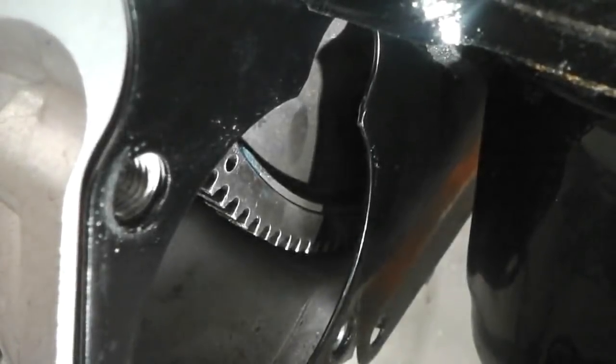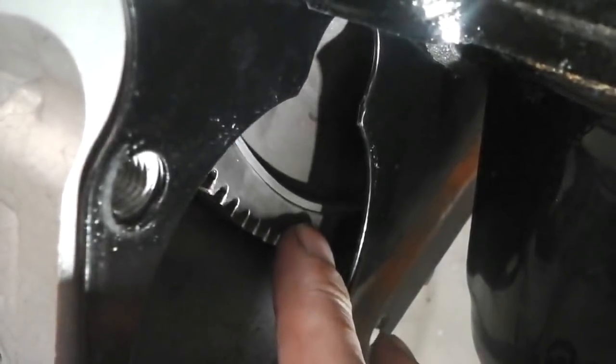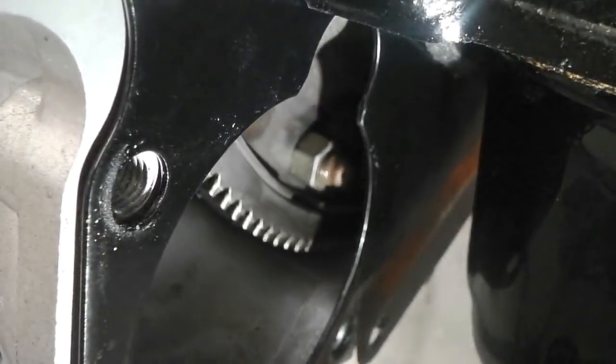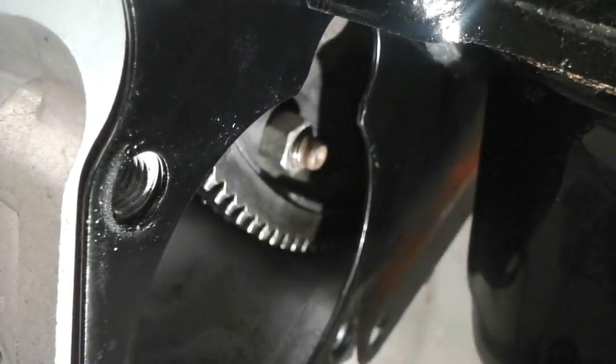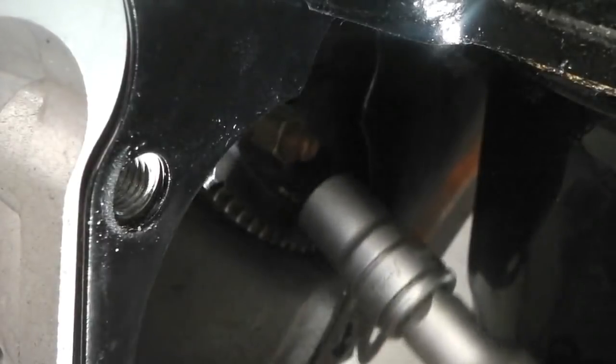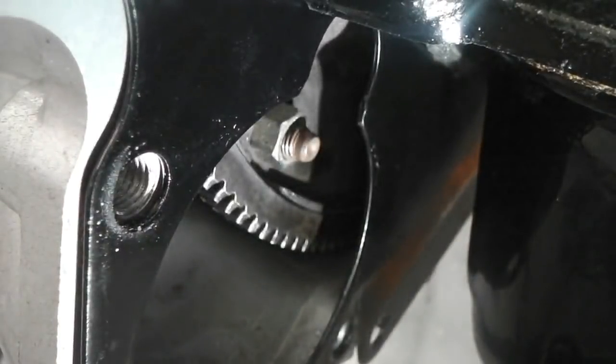Okay, we're on. And we're on the hunt for the flex plate locking bolts. In my right hand, here's a 19 and a breaker bar to turn the engine round, and you're going to see the locking studs. There's four of them on the torque converter. You'll see them come into view any second. There you go, beautifully in your screen there. That one that's on it there is the wrong type of bolt. We just put them on to secure things and keep the wolf from the door.